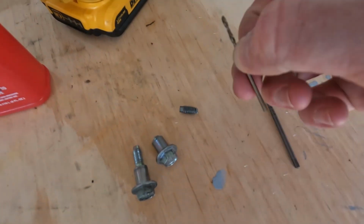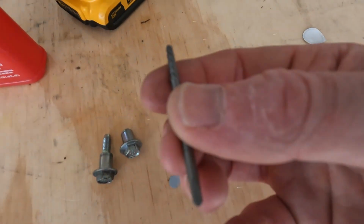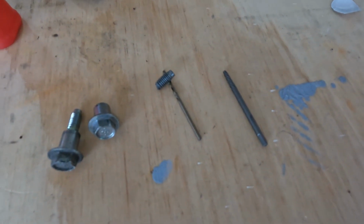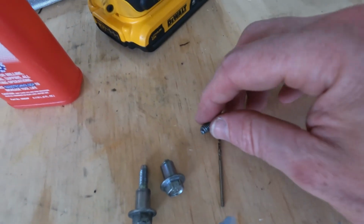When I first started drilling with the drill bit, it actually started moving, and you can see right here, I didn't even have to drill in that far. This thing grabbed right on and pulled it out. I did only show it once, but I did do it in steps of 3. So I drilled a little bit and then used this for a little bit, drilled a little bit more, then did this, and then the last one, it finally came all the way out.